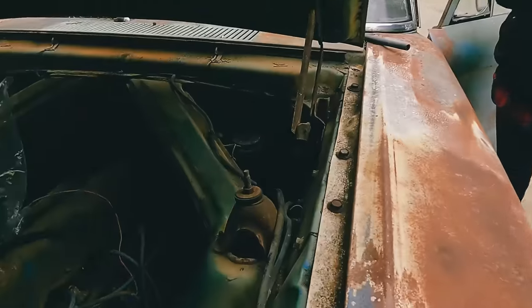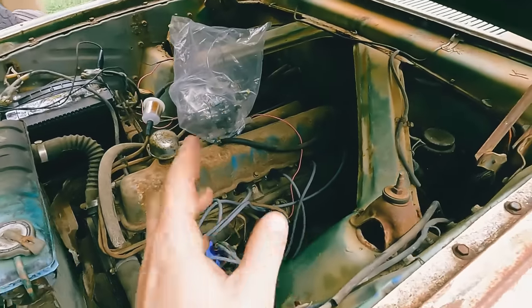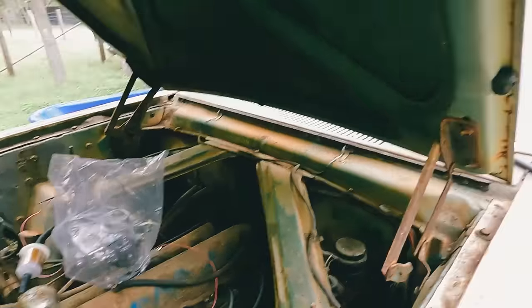Okay, after three different fuel pumps, none of them were working. And so I pushed it down in where it's supposed to go. And while I had it in there, I turned the engine over and I noticed the cam was not activating the lever on the fuel pump. So I looked at the angle of the arm on that fuel pump compared to the original one made in the USA. And the pitch is way different. So it was just barely touching it, not enough to pump it